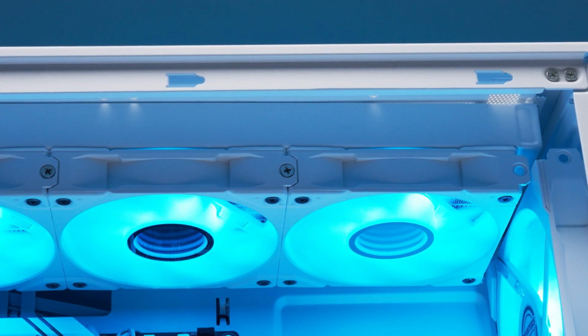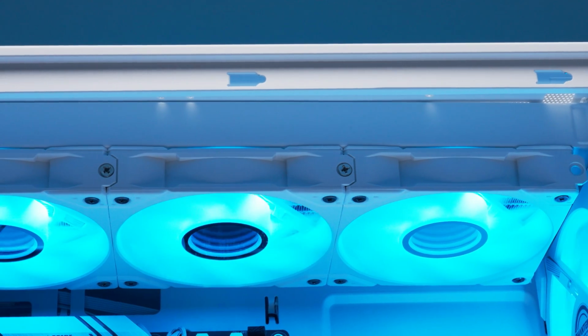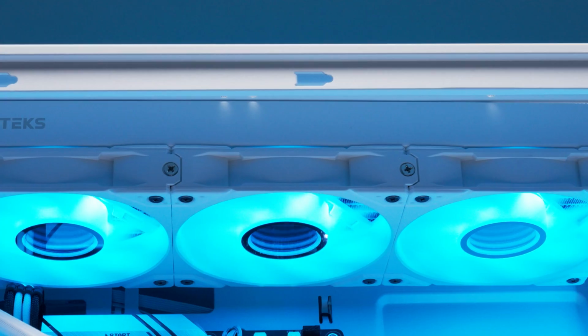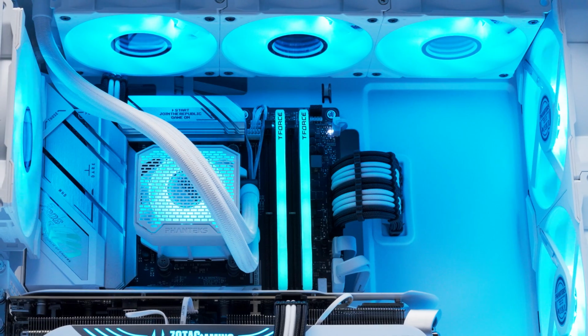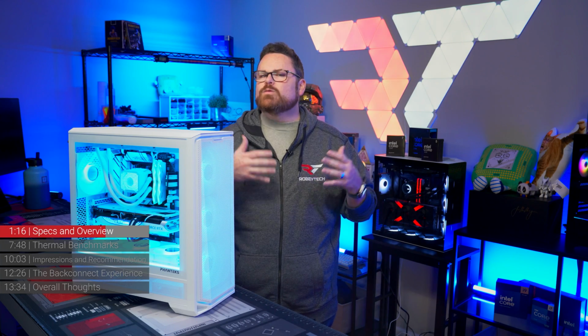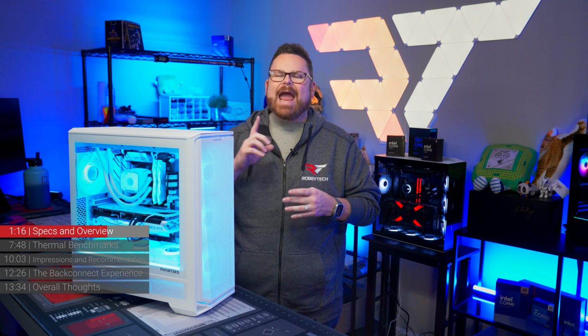As for a 360mm radiator at the case top, there are some considerations here too. Depending on the length and depth of the radiator you would like to use, you may need to remove the rear fan, replace it with a 120mm fan, or run your hoses to the back of the case and hope there's enough clearance for them to fit in between the end of the radiator and the fan itself. This is one of those places where it's worth being conservative on your part sizes. Don't go for one of those dummy thick AIOs and you should be fine.